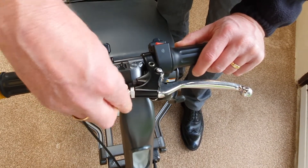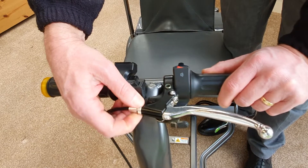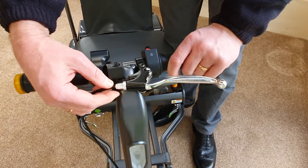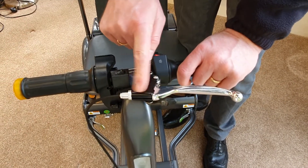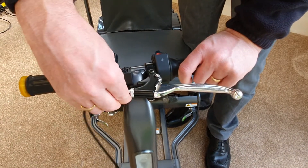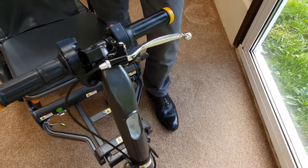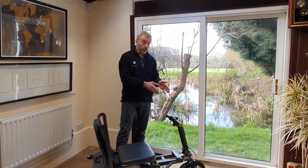When you've adjusted it, make sure this locking nut is locked back against the black frame because that holds everything nice and securely. Sometimes as you tighten the brake this becomes a little bit loose and comes away from the body — it's exactly the same as on a pedal bike. Simply tighten it up nice and secure and that's your brakes adjusted, very simple. There's no real other maintenance on the eFoldie specifically.